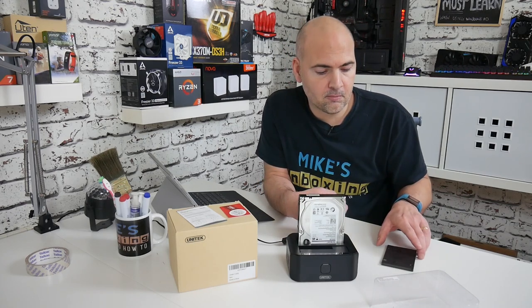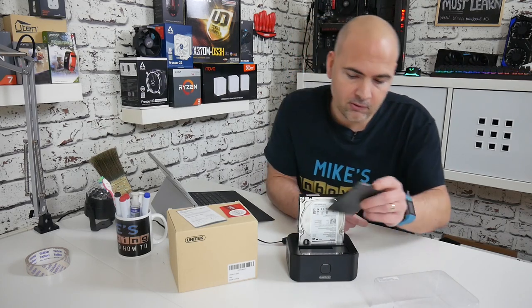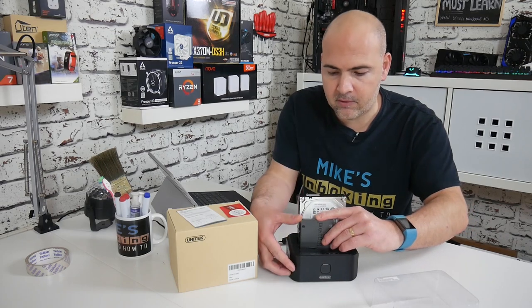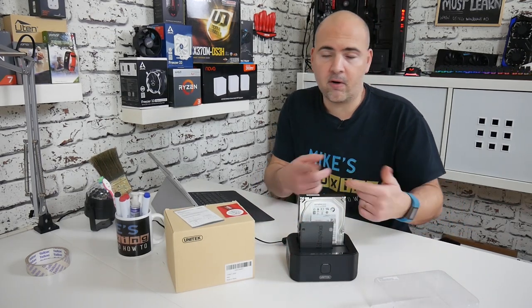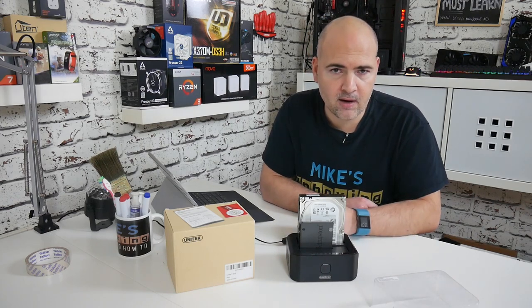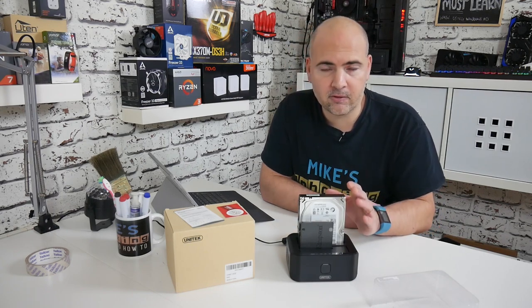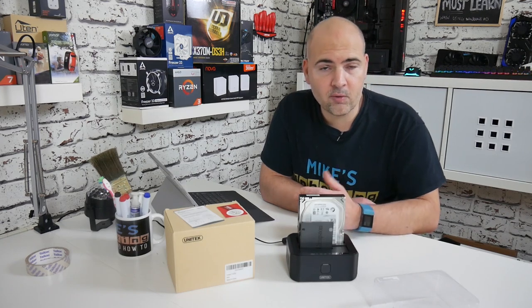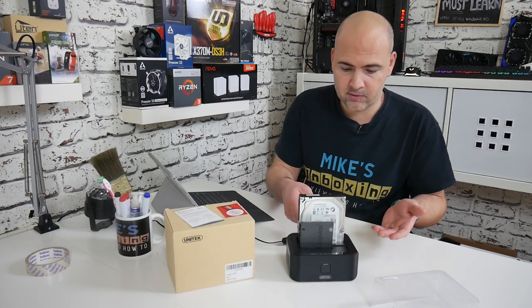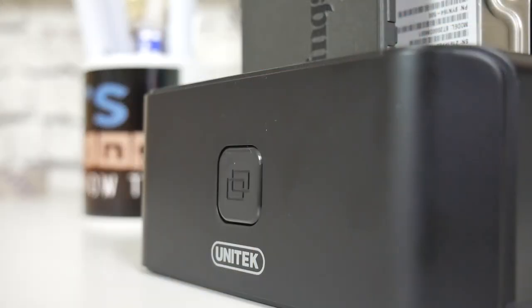Alternatively, if you're upgrading to a newer SSD, you can use it to transfer your old hard disk drive to your new SSD. Just put the two drives into the dock and you can copy files from one to the other — you can do that within Windows, Mac, Linux, or whatever you want. It mounts as a generic mountable drive. Or if you want to use it standalone, just turn the device off, unplug the USB cable, and use the hardware button on the front to initiate a disk clone.